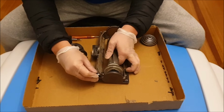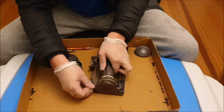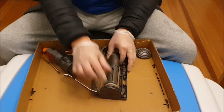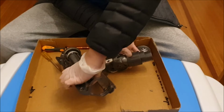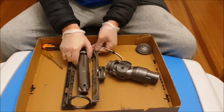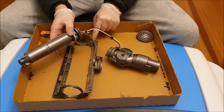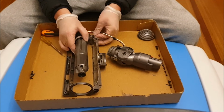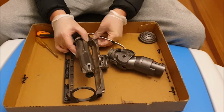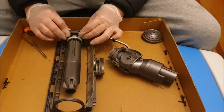So you put in the rubber piece first. After you put in the rubber piece, then you align the motor to go in correctly. So to align the motor to go in correctly, you have to put it diagonally, as you saw. I'm just going to rotate it around and show you again. So this rubber piece goes in here first. And then move your motor diagonally to put the notch in the hole.